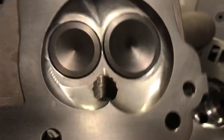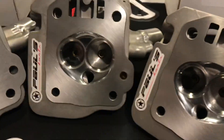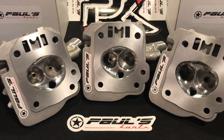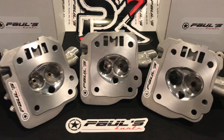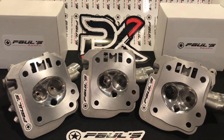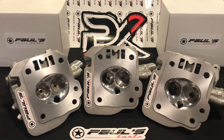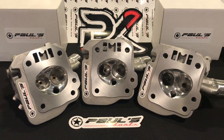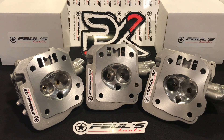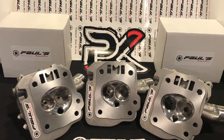What I'd say about this EC head is it's got the wrong chamber shape. This looks like a chamber shape we played with back in what I would call gen-one days or pre-gen days. By the way it looks, it almost looks like it might flow good — and it might. But the flow bench can lie to you. The flow bench is not the do-all end-all that people try to make it out to be. People that quote flow numbers are trying to sell parts — it's become a flow-number-tailored market to the consumer.